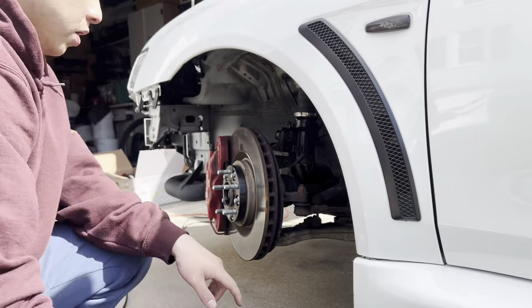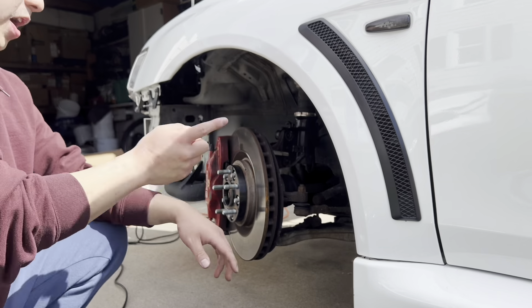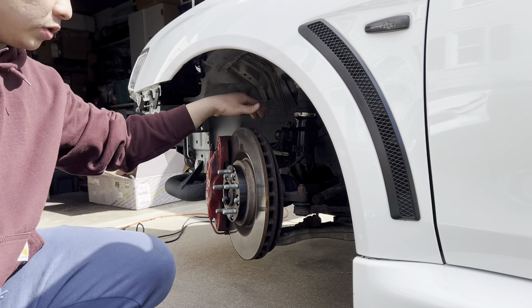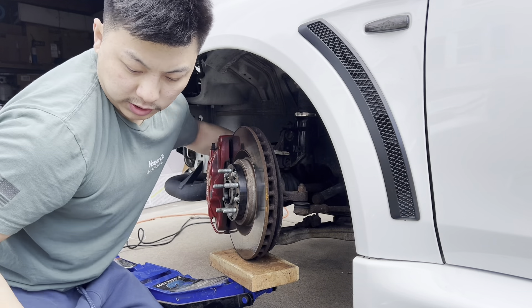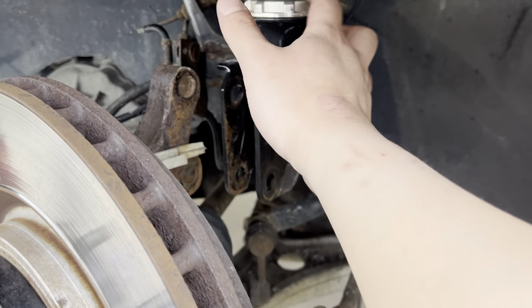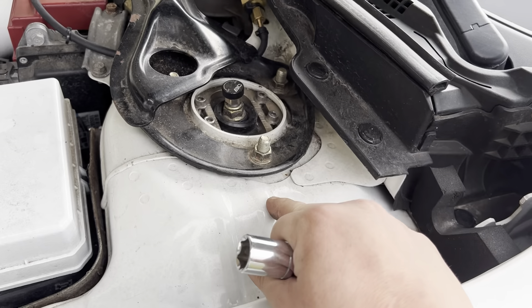Be careful when you do pull those out because this rotor will drop. You want to get a jack and jack up the top so there's not a lot of tension. Since we got this part free, we're going to be going up top using a 14 mil and getting these three nuts off.